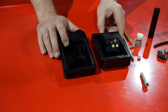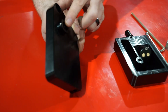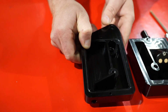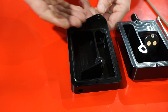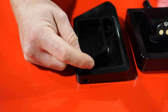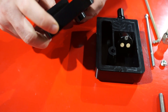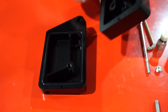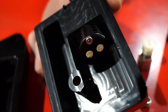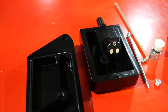One of the major design features is the baffling — it's technically a three-stage system. This slips right over your PCV fitting on the valve cover, your vent fitting. The pressure from the crankcase vents up through here, travels through, and runs into its first baffle. It's channeled through with a drain-back hole, and as everything's pushed up through, we have another system built in — almost like a mini cover with drain ports and flow holes in it.